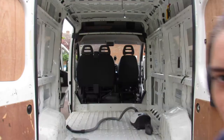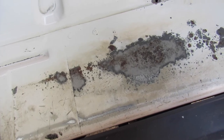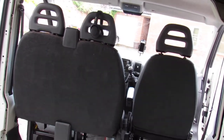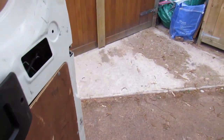My main plans for today, which I've written on the wall, are to dremel and clean up any bits of rust that I can see, give the floor and sides a really good clean, see if I can get any loose paint off where it looks like it's rusting, in preparation for putting some kind of anti-rust paint down like Hammerite or something. I also want to remove the final panels and take up all the panelling on the inside of the cab and floor so I can put some more sound deadening in the cab for better noise reduction, and also suss out where all the wiring goes because I've been trying to put in a reversing camera.